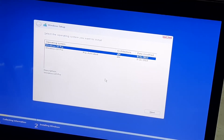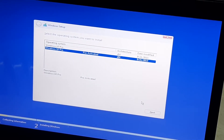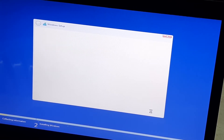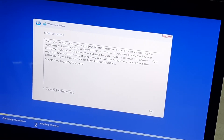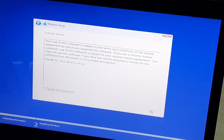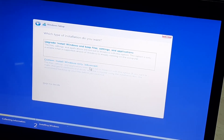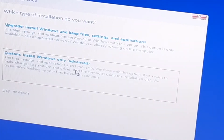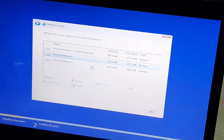I go to Windows 10 Pro. You can use your keyboard or mouse to work and click Next. These are the license terms — you have to accept them because if you don't accept, you cannot move any further. Accept the license, then click Next. Since this is a brand new machine, we are starting from scratch. Go to Custom: Install Windows only (Advanced) and click that.